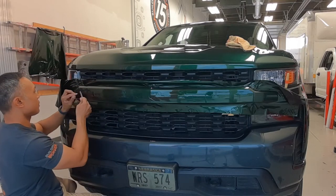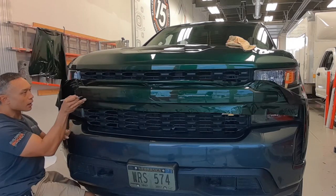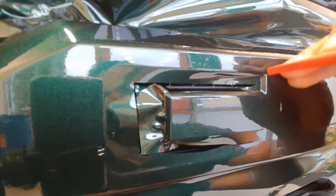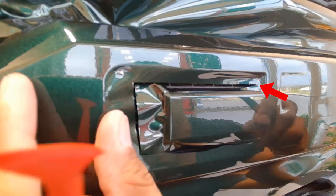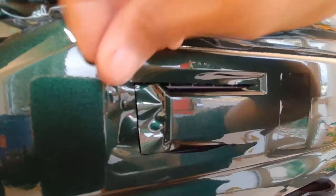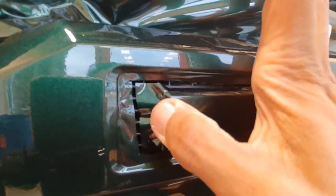I went ahead and started to cut out each of the individual letters before finishing up the rest of the grill bar, because if I mess up it's going to be in these letters and I'd hate to get the whole grill bar done and then have to redo the whole thing. There are a couple ledges inside the lettering itself — you can see I'm getting the vinyl to a ledge, and it kind of goes in and forms another ledge before going straight into the grill emblem. I'm forming the vinyl up to those lines to give myself a cutting surface.